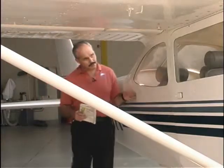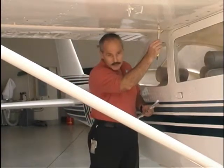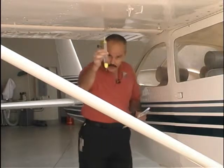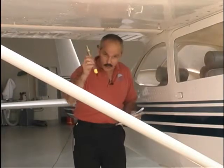Still tapping all the way around the aircraft. Now we're coming up to the fuel sample area. Use your fuel sampler coming up here. What we're checking for is contaminants and also water. If we have any water, it'll show in our little cup here. Check it, turn it around — we're good to go.